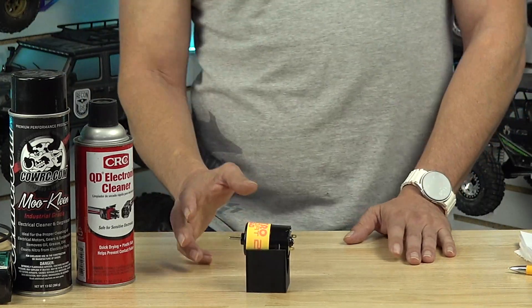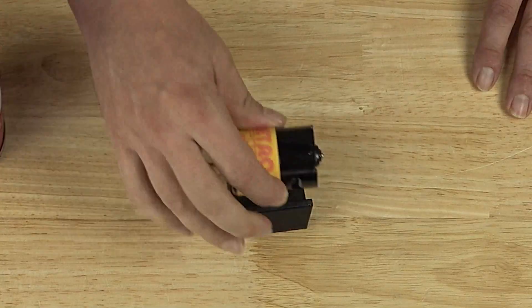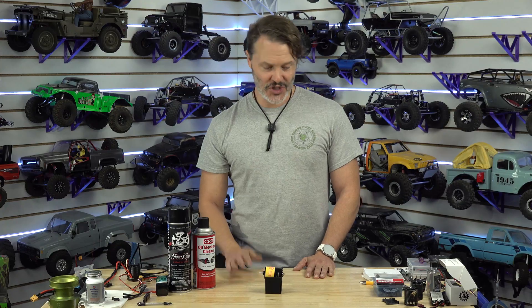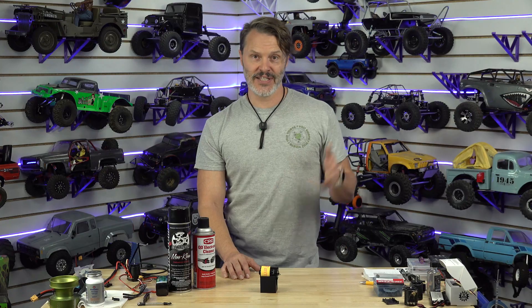So if you're going to be racing with one of our sealed cans, the water break-in method is actually a good way to do it. It doesn't take very long as opposed to a dry break-in method. If you're going to do a dry break-in on one of these, it's going to be something like three volts for potentially eight hours. It's a pretty hard brush compound, and the way they're shaped, they don't come fully conformed to your commutator. Our brush shape is going to be something like a C, and then we have our commutator which is nice and round, but that C is only pressing on the edges at first. We want to make that commutator and that brush fit together. A dry break-in may be something like eight hours at three volts, and then an hour at six volts or something like that. Majority of you are going to be running a two-cell LiPo in these racing classes, but that takes a really long time — you've got to be on it and you're going to be listening to that thing hum for a really long time.